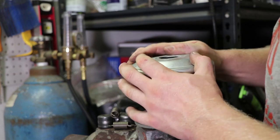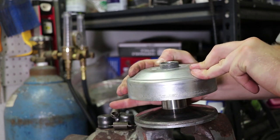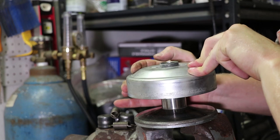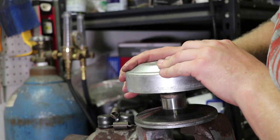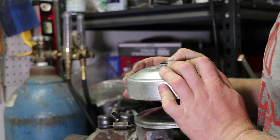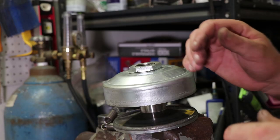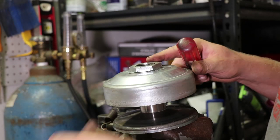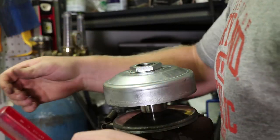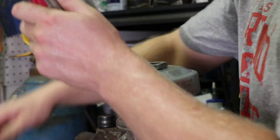The reason why it's wearing like that is that once you get it in place where it's supposed to be, the bottom's not rotating but the top is just a tiny bit. So that is just another design flaw that's not in the original Comet 40 series — this is the knockoff version. We're seeing a little bit of wear there, so that might be a point of wear as you have a lot of torque, just going to keep wearing it out and wallowing it out. I torqued it down pretty hard off camera and we're not getting that wobble back and forth, so that could be a good thing or a bad thing. And then to lock it in place, looks like we just bend this up.